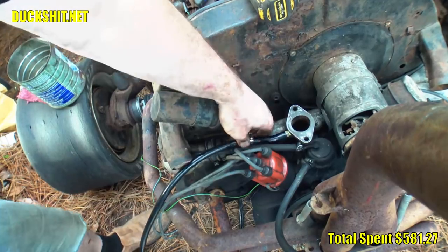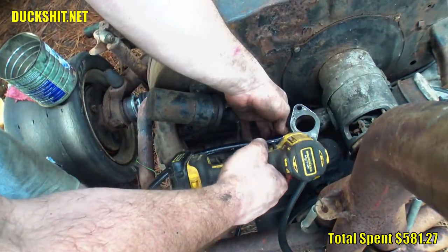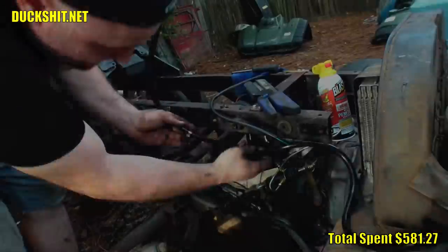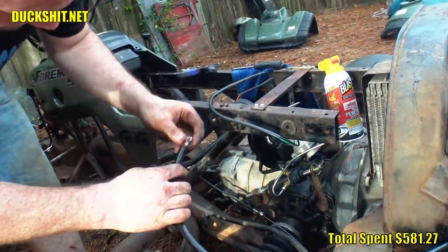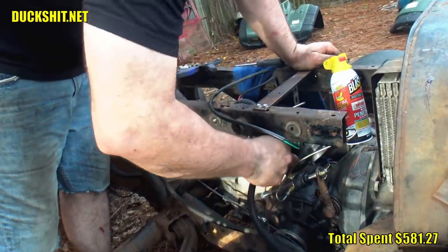So I put the vacuum line on before I installed the carburetor for ease of access. This looks really good, but wow, there's a lot of things jammed together in that area. But it should still work okay. I routed the vacuum line up to the vacuum servo and cut it to length, and then installed it on the vacuum canister. And then back went on the carburetor, the fan belt, and the throttle cable.